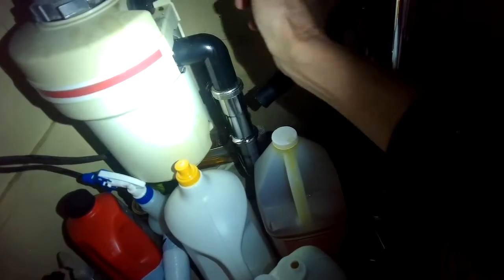If you have one of those air gaps up by your sink, you can see if there's some stuff caught in there, then disconnect it from the air gap — that's a very common place where things get caught. I'm going to check here with my screwdriver to make sure there's nothing caught in the garbage disposal.